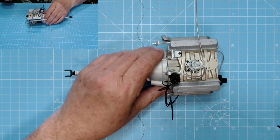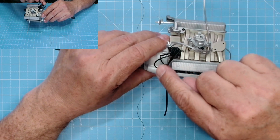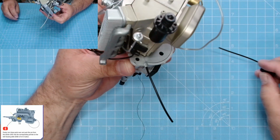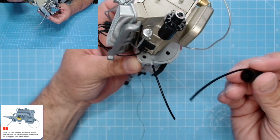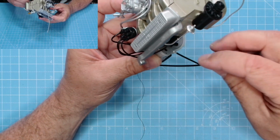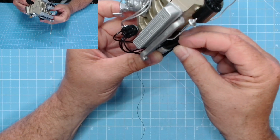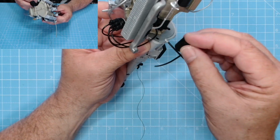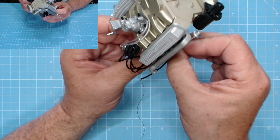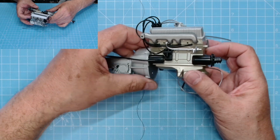Now we need the starter motor, which will come around this side. The spark plugs have come off. Ignition wires have come off. Okay, now all my spark plug ignition wires are in place. We can pop the starter motor into place, which will go here. There we go. There's a little location peg as well as the middle peg, which will help to keep that into place. Get that turned around, and maybe this would have been better going on earlier actually, because that is in the way. Start there, through there, that bracket, that is where it goes.